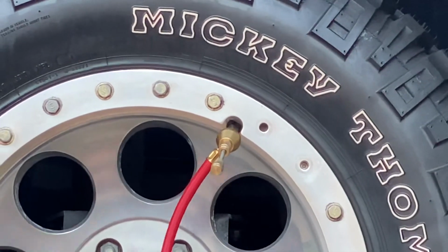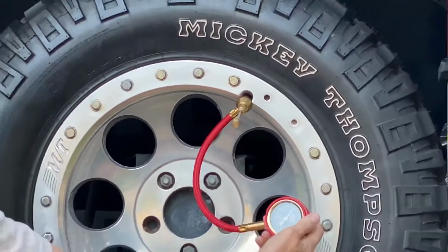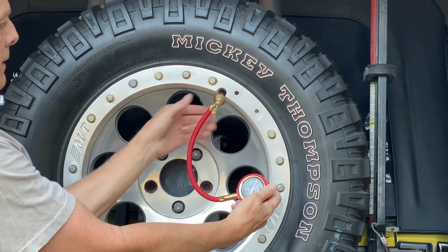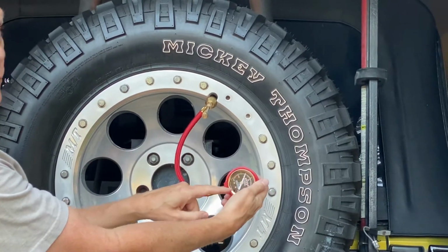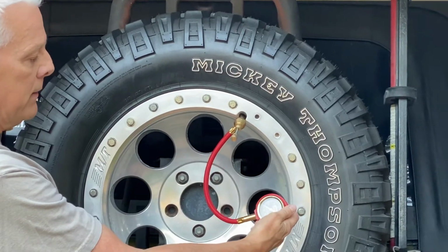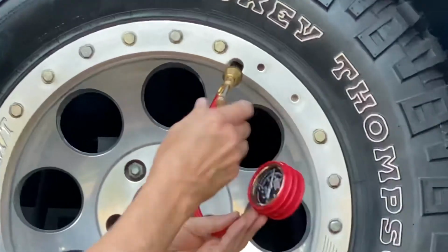And you can watch your air gauge. You want to stop it, you push this in, it stops it. You want to deflate, push it out. Stop it, check your pressure, see where your pressure's at. Again, let air pressure out. And this is relatively fast. You can do this in under 3 minutes, deflating your tire down to 0.